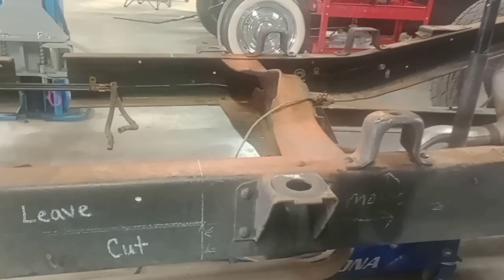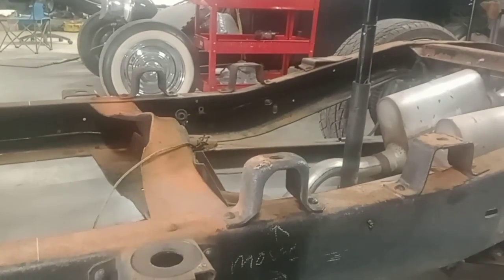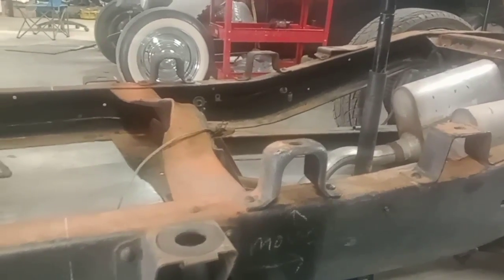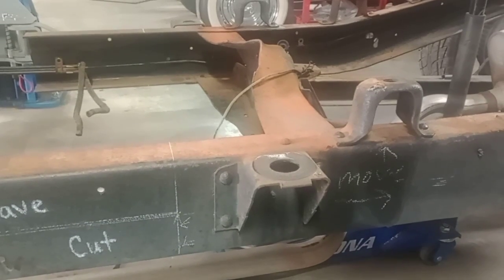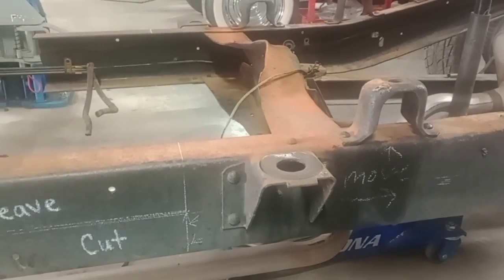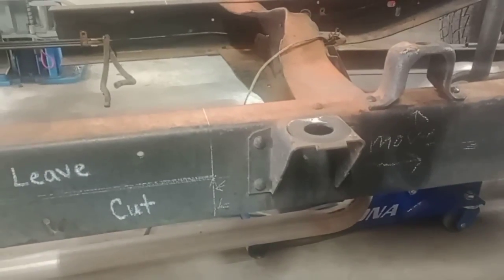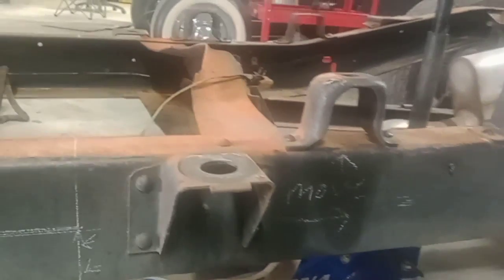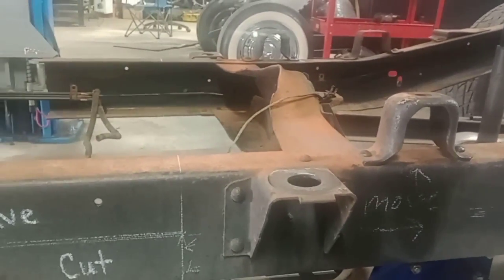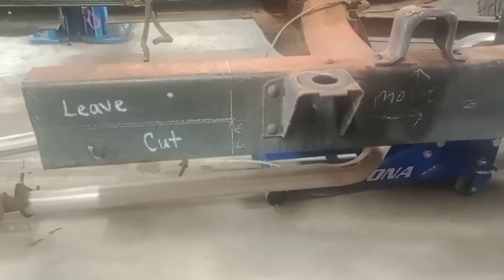On another note, after you use that as a reference point to measure off of, I always move, so you see where I say that, you remove that top front bed mount brace. I grind them and just knock them off. Chiseling them off, my chisels get worn out quick because of that. I used to chisel them all off. I just got a good grinder, and I grind the heads off and knock them out. Same way here. Grind it. Take your time on that though. You ain't gonna need that no more, that's going away. But you're gonna have to remove that and move it back 1 foot. Re-drill the holes, and I get anchor carriage bolts so it looks like a factory head rivet after it's painted, and bolt it back on.